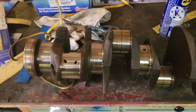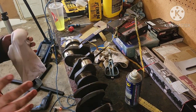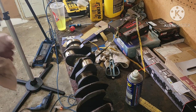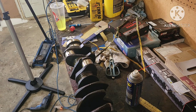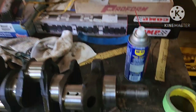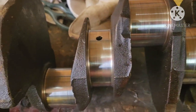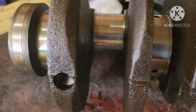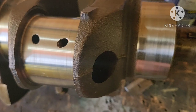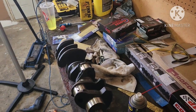I'm probably going to go over the whole crankshaft with 800 grit as well — this will give it that much better of a finish. I'm going to go ahead and do the other three rod journals and I'll be back once I'm done to go over it with 800. I'm finished with my 600 grit sandpaper. You can see — no more varnish on any of the journals. Look at how good they all look with just 20 to 30 seconds of sanding each with 600 grit.